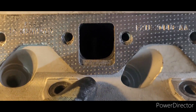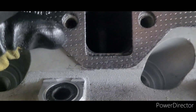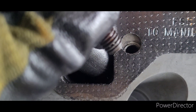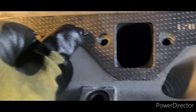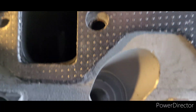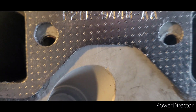It would appear that I have the wrong exhaust gaskets — you can see how far off this thing is, it's horrible and it overlaps the top two. There's no real way to get it up with the bolt holes still lining up. If you don't have any bolts in it, the ports fit relatively well, so I may have to trim out the bottom of these bolt holes to get these to sit straight. These are Ford Motorsport gaskets, so I guess Trick Flow just needs their own gaskets. I'm probably just going to trim the bolt holes and RTV them in place.